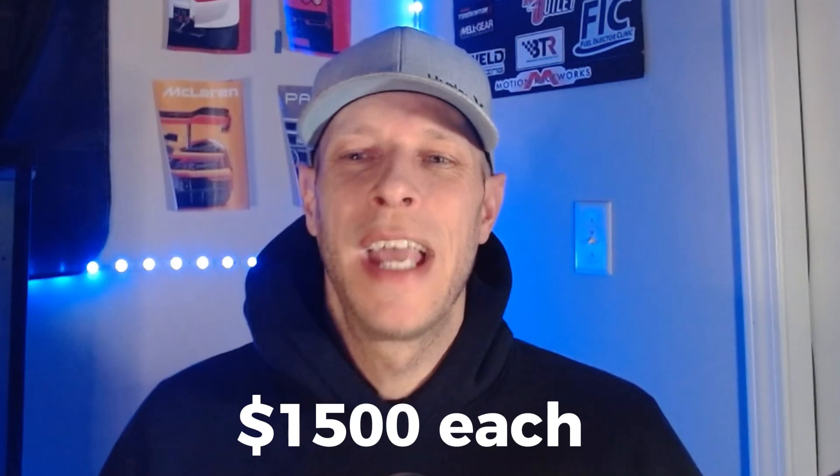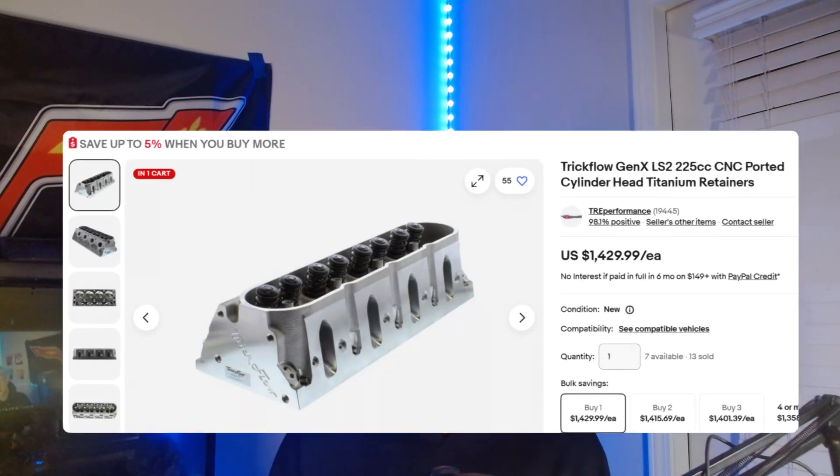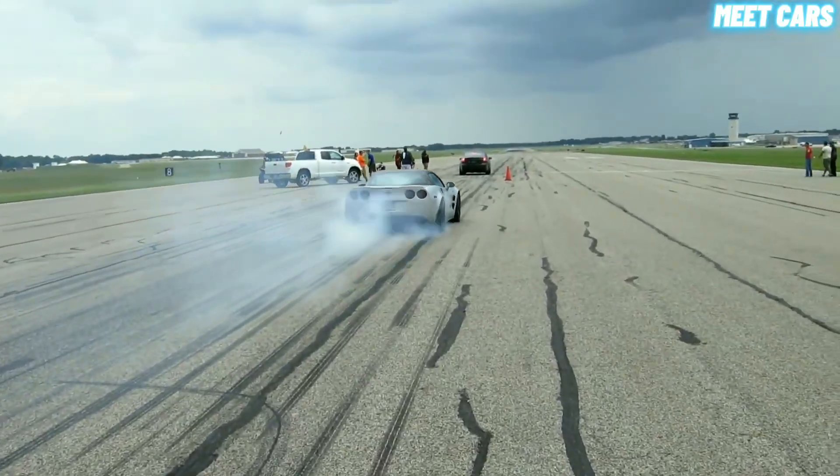It's not a crazy job. You're looking at about $800 compared to buying a new set of heads, which are easily going to be twice that. And if you get a new set of heads, you've got to start worrying about pushrod length and a couple of other factors that can complicate things. So the best bang for the buck if you've got an LS3 is just porting those 823 heads. There are aftermarket options — Trickflow, Edelbrock, Texas Speed — but for the price versus horsepower, it's not great.